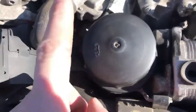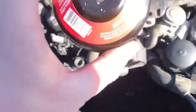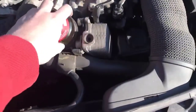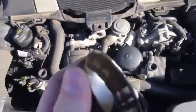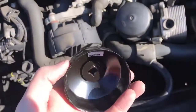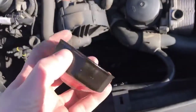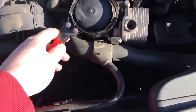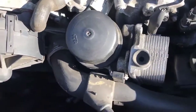Once you locate the oil filter like I just showed you, you'll want to take it off with one of these little wrenches, if you have one. I actually went to buy this, and this is an Autocraft brand. Do not buy it, it's junk. For one, as you can see, it grips if you can push it down, but mine was too tight. It does not grip very well. So if somebody's over-tightened this like it shouldn't be, this is not going to work for you. I would just recommend not buying this brand, because if you look online, after I got home, you can see that the reviews all kind of suck too. But I ended up getting it off just with the old wrench right here on the top. It's not really a recommended way to do it, but this I already had, and I didn't want to go all the way back to the parts store again. But we got it off.